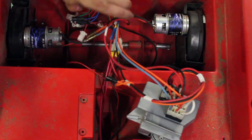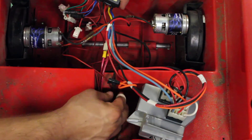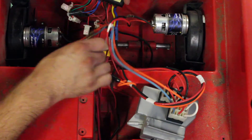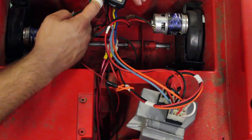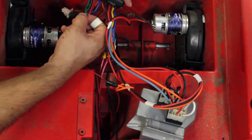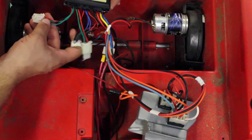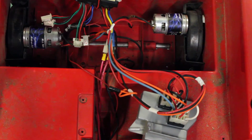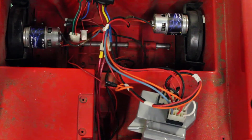The next item is the new pedal itself — it has three wires encased in one jacket, coming through as a single black cord. It connects via the same three-prong plug that fits right into the speed controller — red, black, and green wires on the edge of the controller. There are also unused ports: a small one in the middle for charging batteries (I didn't have a 24-volt charger), and ports for brake lights and a stoplight, which I left unplugged.